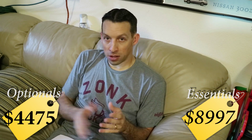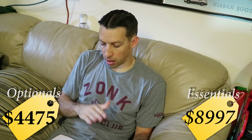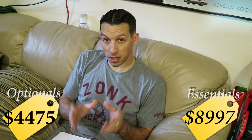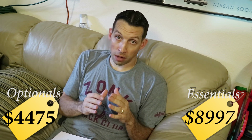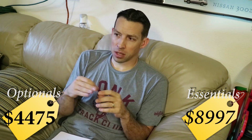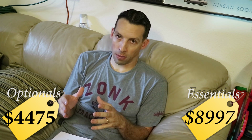Now let's talk about exhaust system. We already talked about how I upgraded the manifolds and the downpipes, so we're not going to cover that. That's already over here. But what you are going to need is the RB26 Y pipe that connects the two downpipes and puts it into one exhaust pipe. This is one of those things that I bought off of eBay because I knew I was going to cut it up. I was going to bang it up because at this point, the exhaust really was experimental to see how it would all work.